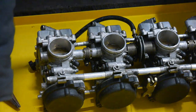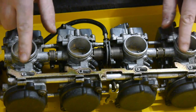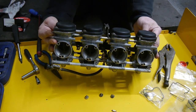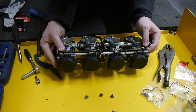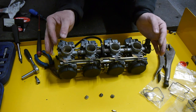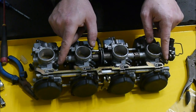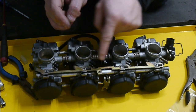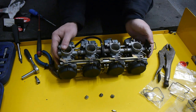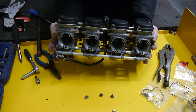Fitting is just the reverse of the removal procedure. Just make sure it lines up with all the little plungers and hooks over the bars, then put in the three screws. You can just tighten it gently with needle nose pliers as it's only plastic. That is your basic rebuild on the 600 GSX-F. If you really want to strip them apart further you can, but just be very careful getting things lined up again as this can really throw off calibrations. When it comes time to do the balancing of the carbs, these are where you put the vacuum pipes — and this port is the one that goes to the valve in the tank to start the fuel moving. Hopefully that was helpful — thanks very much for watching, please like and subscribe if you're new here.